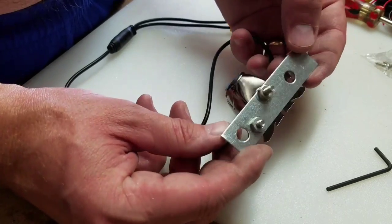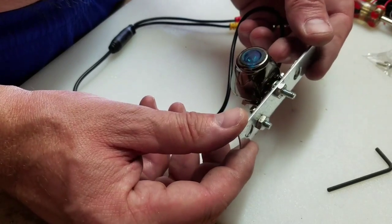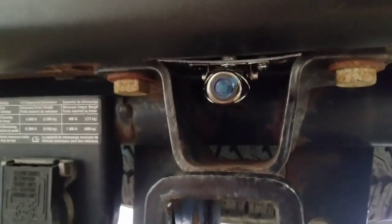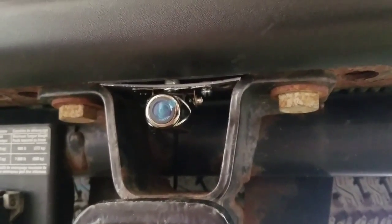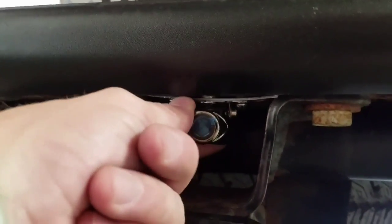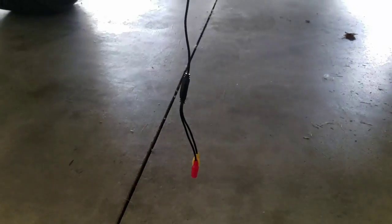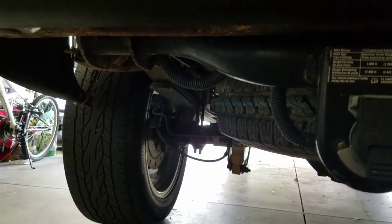I believe I've successfully mounted this to this plate here, so this should allow me to slip it up in there. I'm going to cut off the excess on the bolts so they don't get in the way. Okay, there it is, all mounted in there — it actually worked out really, really well. You can see how it sort of tucks up in there. I cut that little metal bracket piece a little longer than it needed to be so that it would be held in place under its own spring tension. In addition, the nuts on top are pushing against it, and this thing is extremely tight and very solid. So the only thing left to do is the wiring — find a channel and a way to come up inside the cab.